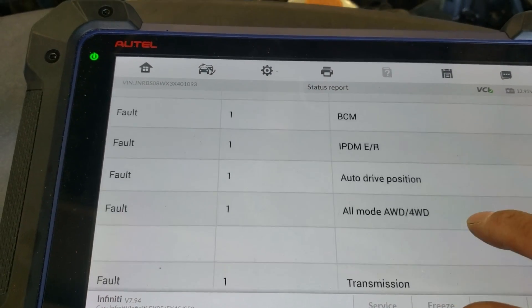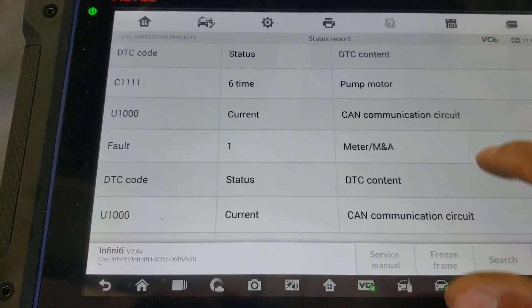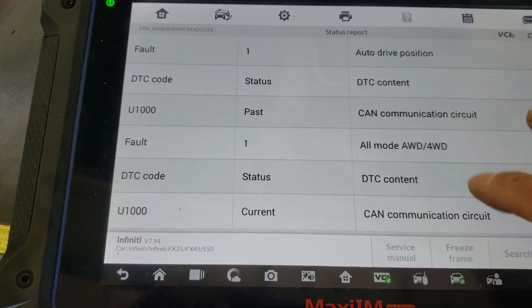I'm kind of hesitant about the computer, because I think if we put a computer in there we might fry the new computer - I can't prove that. I spent a lot of time scope testing all kinds of stuff. The standard stuff does apply: we got a CAN bus, and most CAN buses have the two 120-ohm resistors that should be reading 60 ohms when they're in parallel. On this vehicle I did have to disconnect the battery to get the 60 ohms at the DLC pins 6 and 14 - so that was good. Then I went to the computer and started checking powers and grounds.